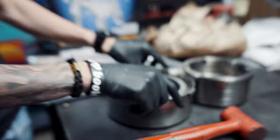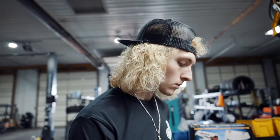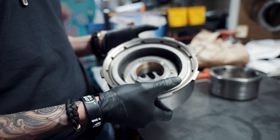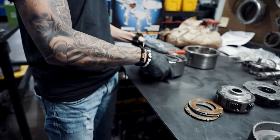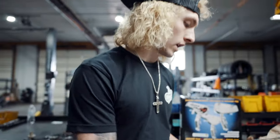I have my tolerance, which I'm not explaining to you. So anyways, I have my tolerance. We're using a stock direct apply piston. I used the billet one in the sober truck, so I'm gonna try that. Got our new bushing installed as well. I'm running GPZ forwards and directs. Can be a really nice trans.